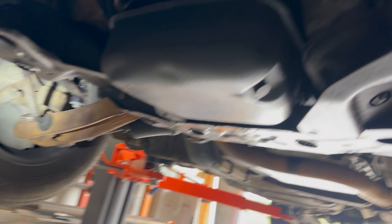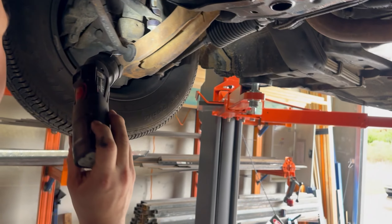When the engine mounts go like that you start thinking you've got a bottom end knock. He's done a fair bit of work on the suspension though, which is probably why it drives so nice. Battery tray's pretty good, just a little bit of rust. It would be worth ripping this motor out at some point because of that rust on the back of the head and all the oil leaks — just rip it out, buy a full gasket kit and re-gasket it. It's got a rope seal.